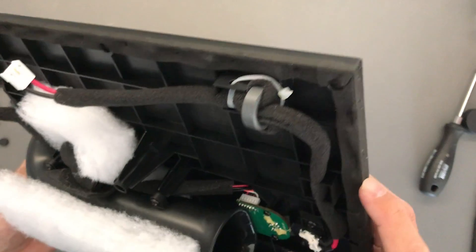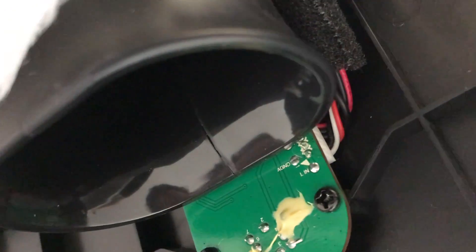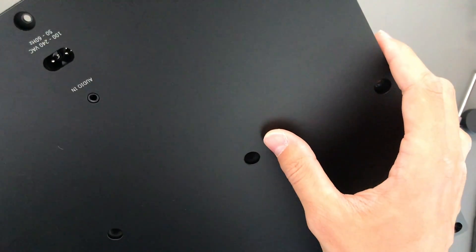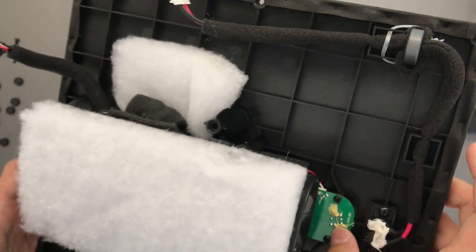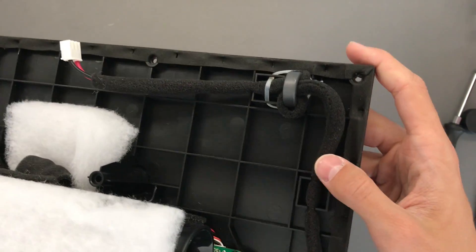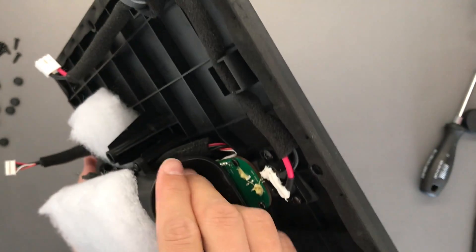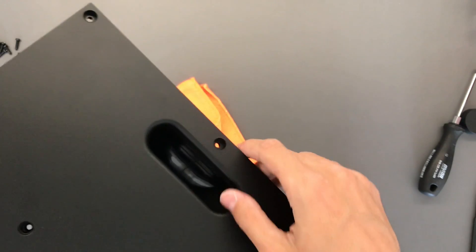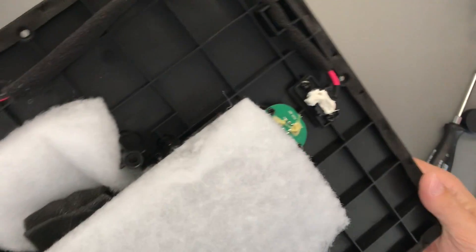It has connectors going up and quite a few wires — very nice that they have labeled them. Seriously though, why does it have so many? There's no optical in, so I don't know why. They could have two grounds to detect when something is plugged in, but beyond that I have no idea. There's a little ferrite bead on the mains input wire, crimped into the case — quite elegant. The subwoofer port is tapered on both sides, so there'll be some turbulence and wind noise, but the first audition was fine.